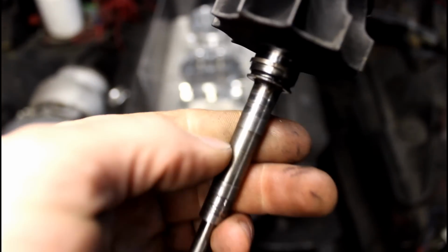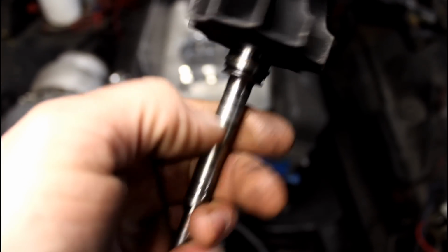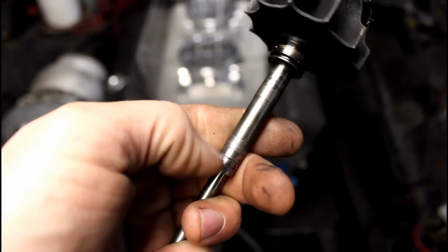Just wanted to give you a little update on the T. Got the valve train issue sorted out, and immediately one of the turbos gave up. And these are just four little junkyard T3s, and I'm pretty sure that this T3 is why that car ended up in the junkyard. It looked like the oil hadn't been changed in a very long time. The shaft for the turbine was all gouged, and fortunately, I had a spare one, so I pulled it apart. I bought a $28 rebuild kit from Amazon. I was really surprised. Put it back together and it seems happy now.